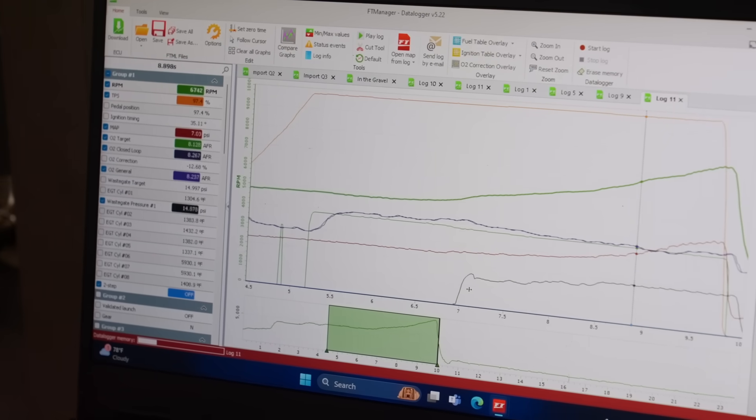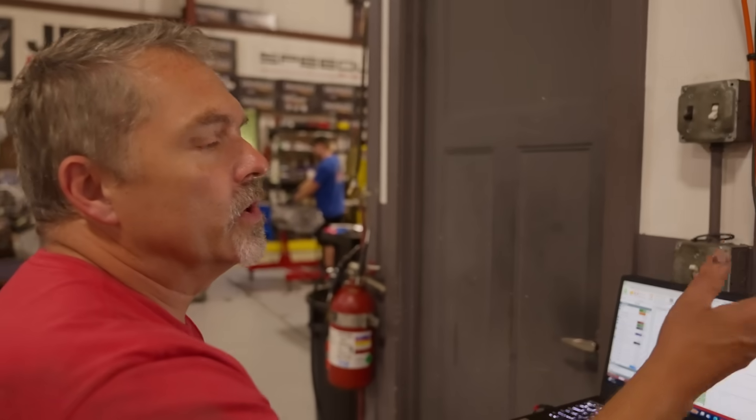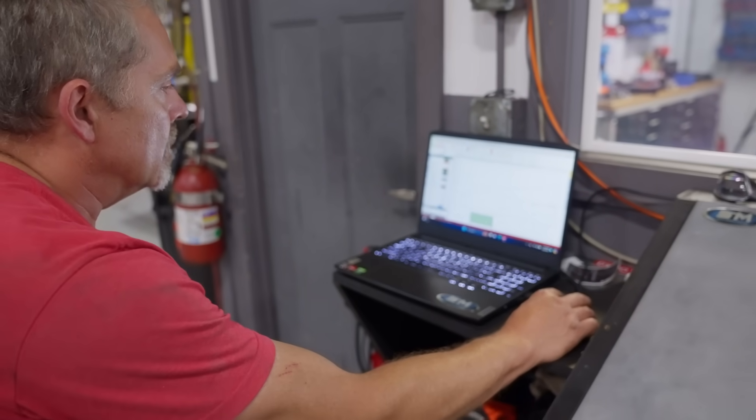It's smoother, it's a little more consistent. At least I proved out that this I think in theory does work. I think the turbo is spinning faster, but it still wasn't spinning fast enough to make big boost because the boost level really didn't jump or do anything weird. So we are back to — the engine is great. I think the turbo, I think everything's going to be fine in the car. You could end up doing this exact same thing or similar to it. But the nature of and the way all of this works on an engine dyno on a water brake absorber, we're just not able to test this correctly — I'm going to spend another two days and another 25 pulls trying to figure out how to just get it to test accurately.